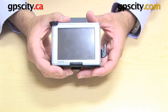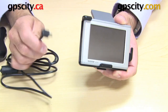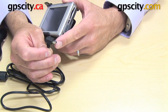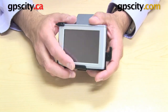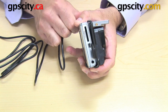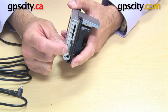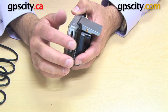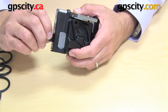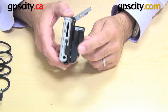One of the things to note is that a lot of the newer Garmin USB cables have that right angle USB head — a lot of these newer cables for the newer Nuvis have a different head design than what came with this GPS when it was first purchased. There is a smaller right angle end on the cables that came with this unit. This little hook here allows you to hook in that USB cable prior to sliding it back into the cradle. On a motorbike or other high-vibration area, it stops the USB falling out — that was an issue at the beginning. But if you have one of these newer USBs, all you need to do is get some sort of tool and just break that hook off. It just snaps straight off cleanly along the edge.